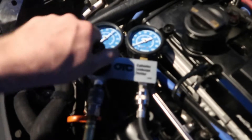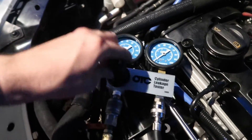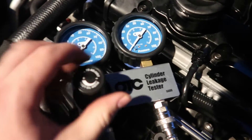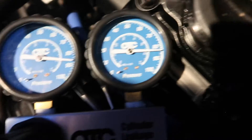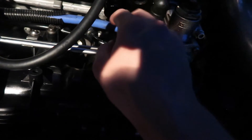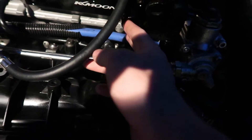Alright, let's bring this back down — rotate the crank just a tiny tiny bit and see if that exhaust valve is actually just open a little bit. It might just be open a little bit because these cams are a little bit bigger. Maybe I didn't have it perfectly at top dead center. Okay, let's try this again on three. It's a good thing I retested this — the problem was that the exhaust valve was actually just open a little bit. So that's good news. I only had enough compressed air to get 86 — it's holding 84, so that's actually really good too. So nothing wrong on the leak down. I think I'm feeling the most in the valve cover. Not much in the intake, not much in the crankcase. So maybe that's a sign that my valve seals are bad — not really sure.